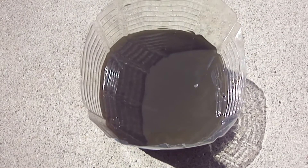Here's a better view of what it looks like. After doing some research, I realized what had happened. Not long ago, I power washed this piece of equipment and accidentally got some water in the hydrostatic system, which caused all the oil to emulsify and turn gray. The way I fixed it was I simply flushed the hydrostatic transmission with new oil.